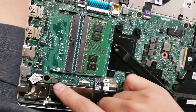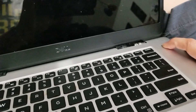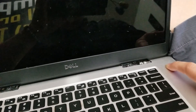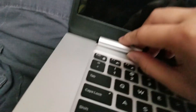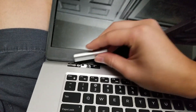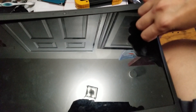Once you've got all of that, there's the charging port here. Once you've got the battery removed, if you're replacing the screen — like every other one — hold the power button down to drain any power out, hold it a few seconds. Normally these caps will be here. To remove them you have to have the screen tilted almost all the way back. These will actually come up when you pull the frame out, so same thing — get something underneath and peel around the edges.